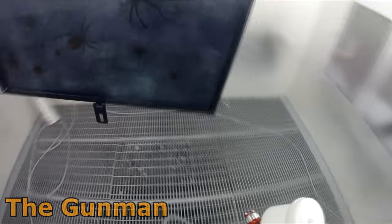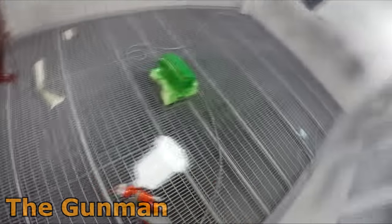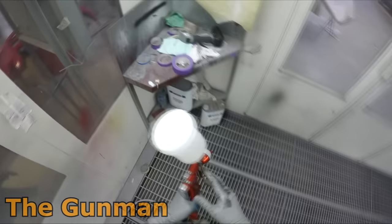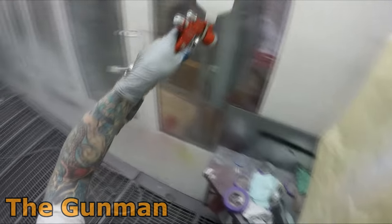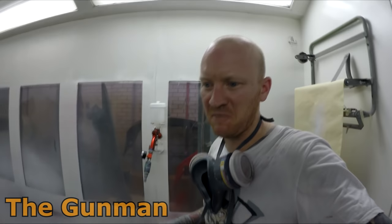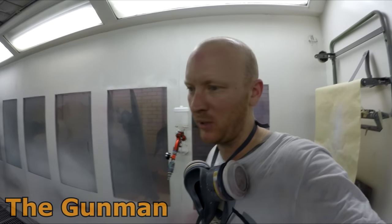Apart from that, it holds a really nice gloss. If you hang around for a few more minutes, I'll give you guys a look at the gloss it holds. And I actually ended up flow coating the lid off that toolbox because I used the flakes on it. So yeah, most of the time when you use flakes, you do need to flow coat. Well, so that's the first coat of clear. That 50 PSI thing was an absolute just not gonna happen type thing.